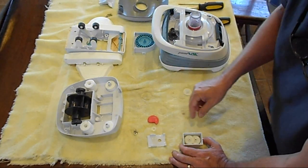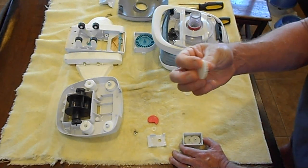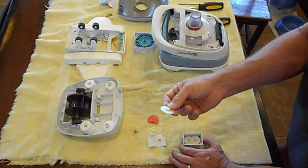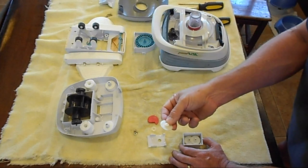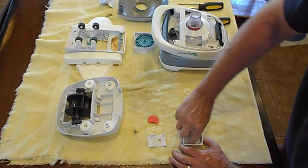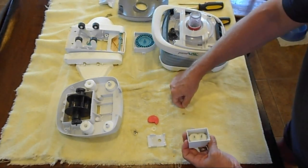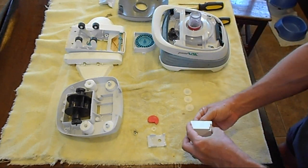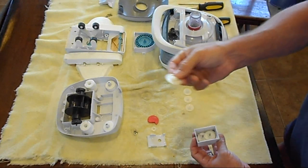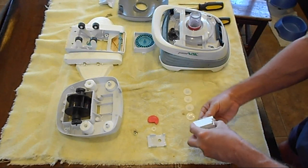This is the biggest culprit when your pool vac is not doing its cycle — not turning left or right, just going straight into a corner. Go right for this gearbox. I've found hair in here, pieces of weed whacker string, wood, and grass. You have to look at these pieces very carefully because you need to see if something is stuck on them — sometimes they stick together because of water. Just one piece of hair can mess these things up, no joke.